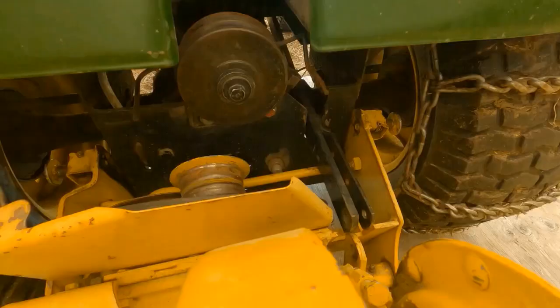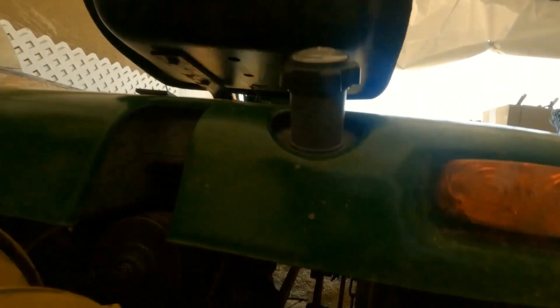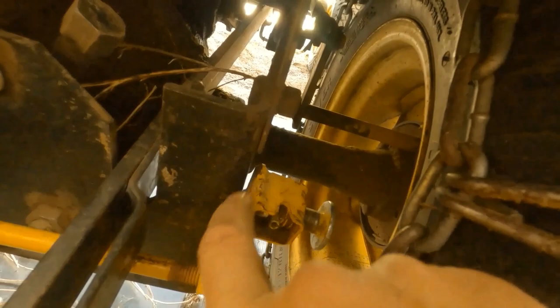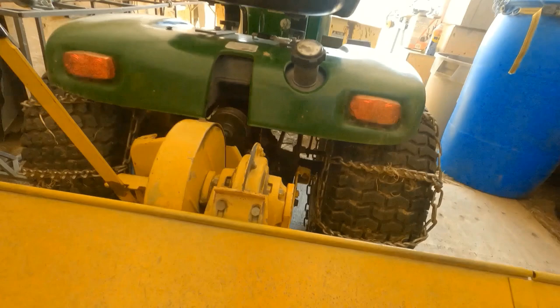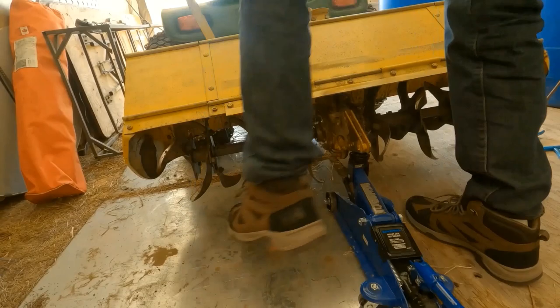By moving the jack around the back here, once you get it up a bit, you can release those. See that there? It's a lock when it's up there, and this thing won't go in. So you got to release that so that it will go in, but not until you get it past where it won't pop out this way. And you got to then lift it up enough to get it in that hole. So usually you can do it. Lift the whole back end up before I go ahead and jack it up. Click, click, she's in.